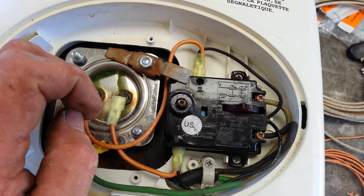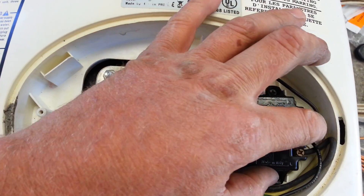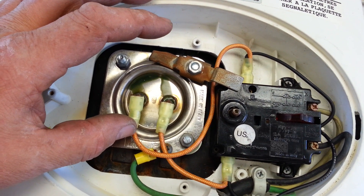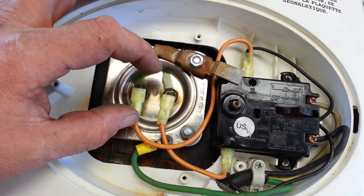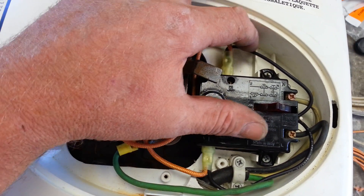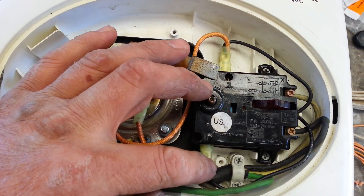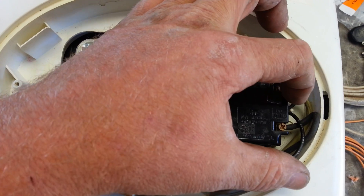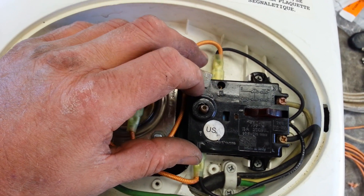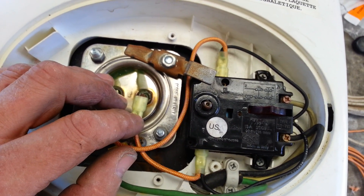We ran our special wire — this is the line side here, this is the load side. This orange wire is a Type X 200 degrees centigrade wire going to the element. The black wire that you see tapping off of it goes to a little indicator light. Here's the neutral side and here's the line side over here. There's a little indicator light underneath the switch — it'll light up red when the element is up and running so you have a visual of when the unit is actually firing.